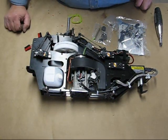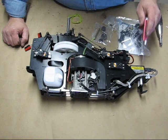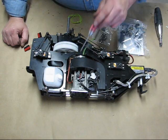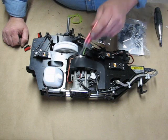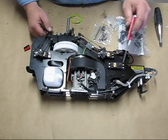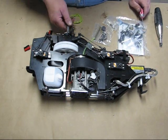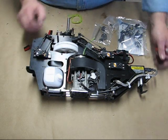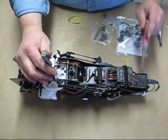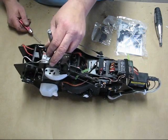I've got most of my electronics installed now. There's a ground wire that comes off the Zenoa CDI that you need to make sure gets onto the engine block, so it has a ground going back. This is my RevMax or Spectrum AR7100 back plate sensor that I wired up and ran across here. The wires come in here for the CDI spark plug and sensor wire. All the servos are mounted. Here's my gyro, here's the receiver, and here's the CDI. I'm going to put my batteries back in here so I can get them in and out without taking the canopy off.